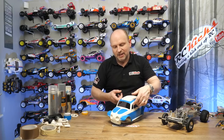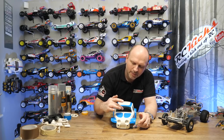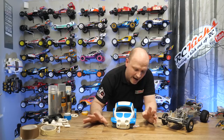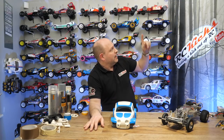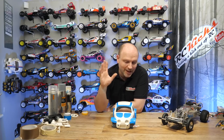The only thing I'm not super happy with at the moment is the front kidneys — these are really hard because of the lip. They came off okay, and my plan is to T-cut around them to hopefully get a super sharp line. I'd like to get them a little sharper since they're right on the bonnet and there's nothing to hide behind. I've also got one fingerprint there to get rid of. But all in all, no runs — it seems to be okay. This is probably one of the most difficult paint jobs I've done, where you just can't hide anything. If you're doing one color onto white, it has to be perfect — otherwise it shows up so badly. So what's next? I'm going to leave this for about four days, then wet sand it and T-cut it all, put the decals on, and then lacquer the lot.